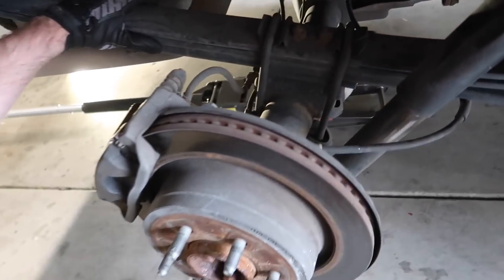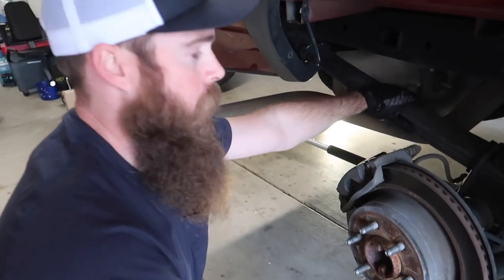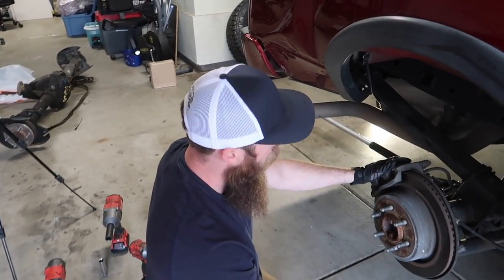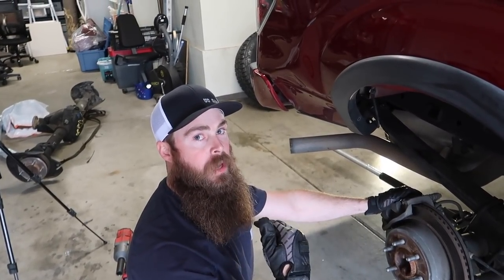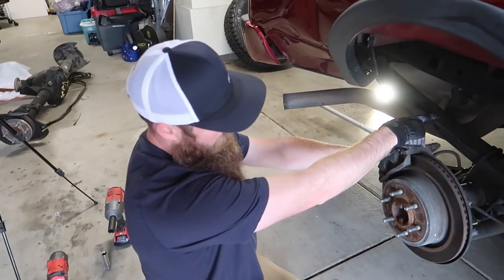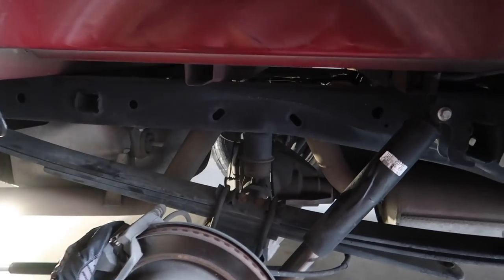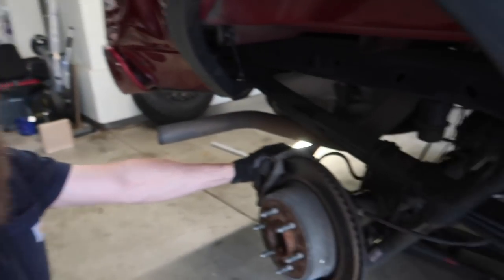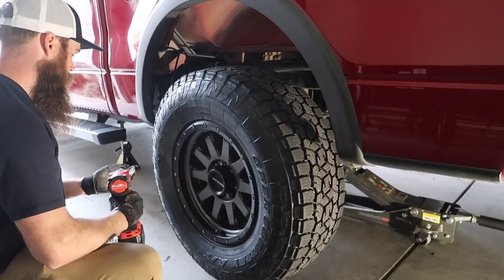But we do need to drain a bunch of stuff, right? Like, we gotta drain the brake lines first, or? Yeah, we'll take the brake calipers. Actually, we'll probably just have the brake calipers. I was gonna say they could hang off, but technically they're installed with the line and we have to transfer the line over. Oh, okay. So anyways, we'll probably disconnect the brakes right underneath at the bulkhead, which is a little spot back there. Okay. And then we'll have to capture the fluid so it doesn't get all over your parents' garage. Good times.